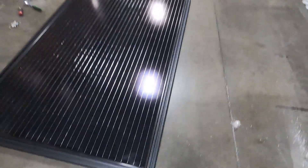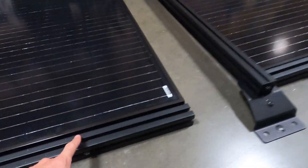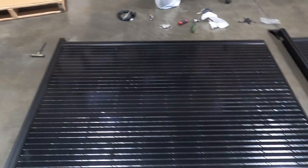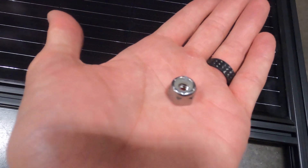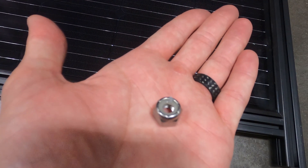Now I'm going to drill the same holes here that I drilled earlier on the other panel — drill those holes into the frame of the solar panel — and then use a two-inch stainless bolt there also with a nylock and a washer. These have a nylon insert so they won't back out or loosen as you're driving or moving.